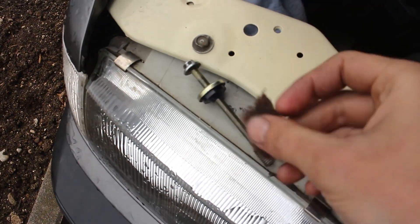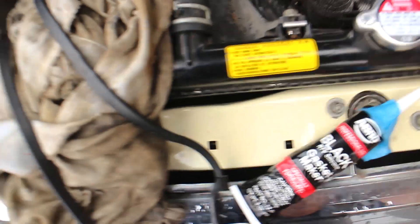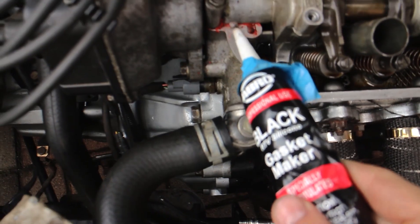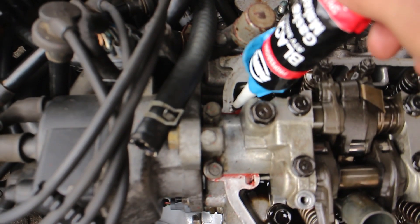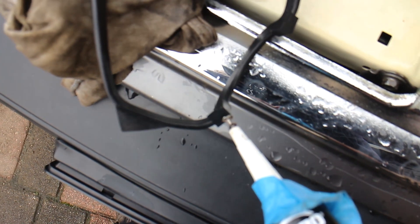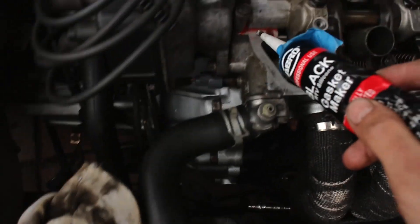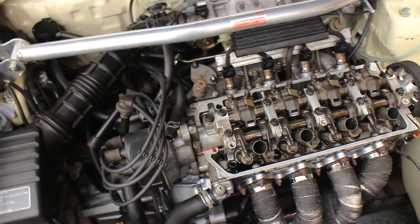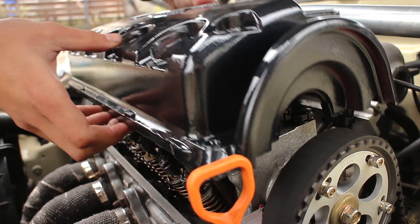Ready to put it on, just cleaned all the surfaces - use some wall mesh or whatever to clean it up. You're gonna need a little gasket maker, so put a little dab on each corner of the caps here, because this is where it always leaks, like here and here. You can see on the gasket right here. Just put a little drop on each corner, put it on, tighten it all down, wait for it to dry a bit, and then you're ready.